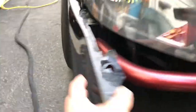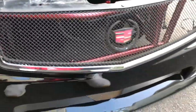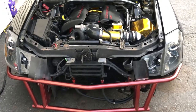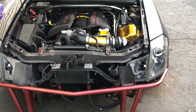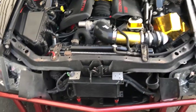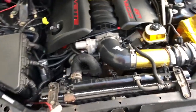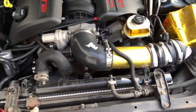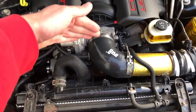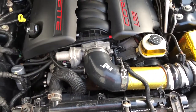So far the push button connectors work great for taking this thing off quickly. I'm just going to get it out of the way here. With that out of the way, it exposes the whole bash bar, which I think I can keep on — that shouldn't cause any interference. Next I'm going to pop the oil cooler off and just kind of swing that out of the way, and then move into taking the rad out, the intake out, and basically working my way inward to where it finally gets to the cam.